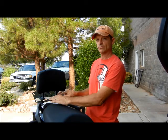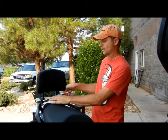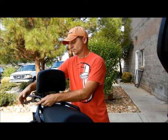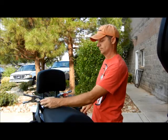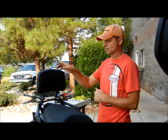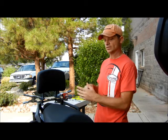The thing that you can do if you want is use the included clamps that we provide. Clamp the backrest over top of the drill guide. After you've clamped the backrest to the drill guide, you can either sit on the bike with your passenger so the passenger can see if that feels like it's in a good position. The clamps will hold it steady, but not enough to put a whole lot of pressure on it. It'll let your passenger get a feel for where it's at, and then you can adjust it from there.